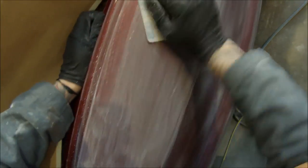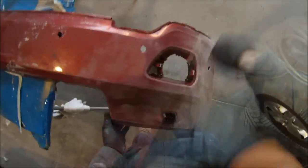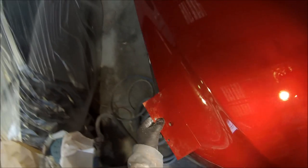I've got some grey scotch brite and I'm going over all the shiny areas with it, because if you paint over shiny paint the new paint's not going to stick. After that's done I've grabbed a piece of 800 on the SoftBac sanding sponge, and I'm going over and taking that 600 grit — which is a touch too coarse to paint over. You can do it but sometimes you'll see the scratches, so I'm going over that with the 800. It's nicer to clear over and to put your base coat over than 600. Keep it clean at all times — use an air duster gun in between each stage. You do one step and then you blow it off, then do another step and blow it off.